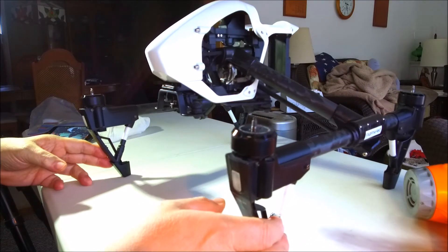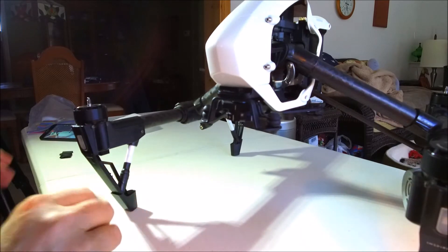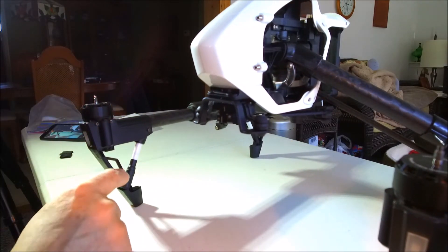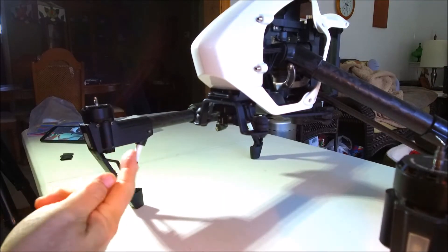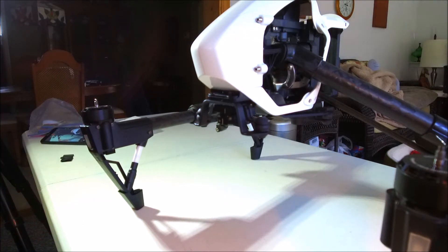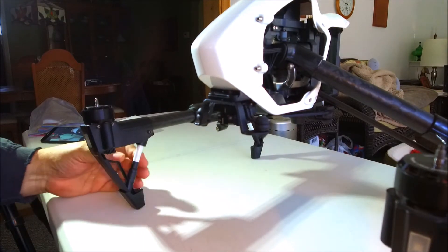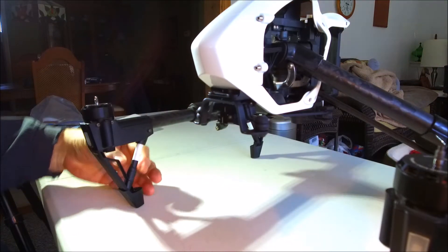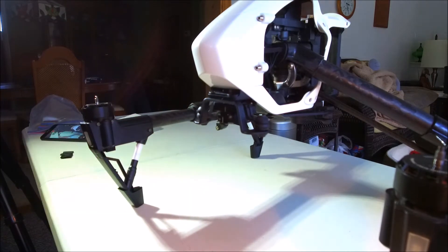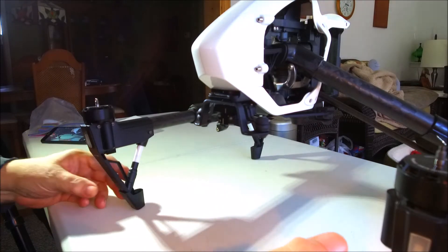You can see here on this one - I've already repaired this one. What I did was I cleaned off the landing gear, pulled it up, and inside the landing gear is a little wire. The oil had already leaked out. The wire broke off down here on the bottom, and the little wire inside had a little plunger in it to keep the oil from slopping around. So I went in there and cut it with a pair of side cutters.